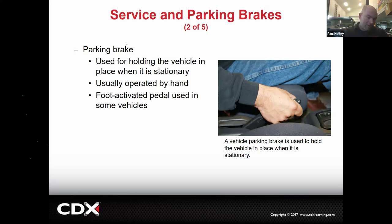It's also not designed to really start off your drift. First off, if you have enough horsepower, you shouldn't really need that handbrake anyway. But if you're really trying to be fancy and want some sort of handbrake drift entry, then convert it to hydraulic and have it actually use the hydraulic so you can make some real pressure. Don't do this janky handbrake-to-a-cable thing. See what I'm saying? The handbrake was designed with a cable just to stop it from rolling.